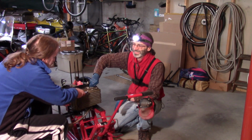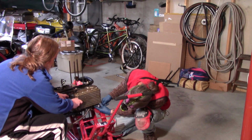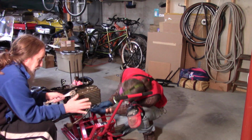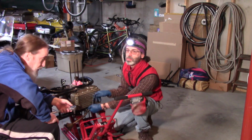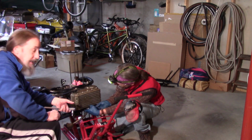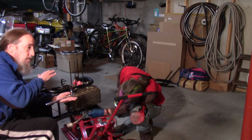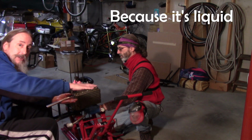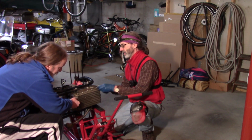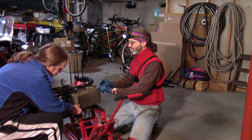Did you watch how he checked the flatness of the oil pan? I did, and I probably would do that for the front cover because that thing's a little whacked. But I don't have a plate of glass. What he's talking about is in Brooke's video, to make sure this was flat, he put it on a plate of glass and then ran feeler gauges around it, and when he found out it wasn't flat, he put it on a piece of sandpaper and just slowly sanded it until it's flat, because when you lay out glass, it automatically levels. If you haven't noticed, we're kind of Brooke's Garage fanboys. I couldn't imagine being quite as detailed as he is, but you gotta respect it.